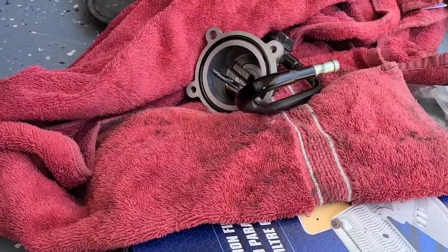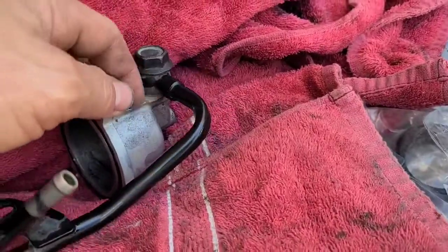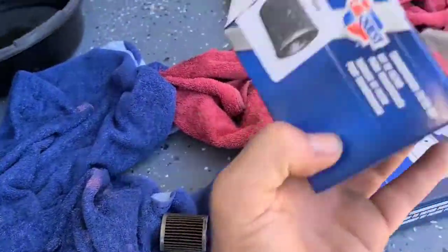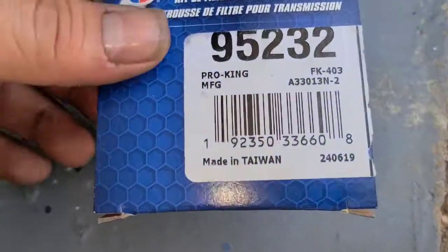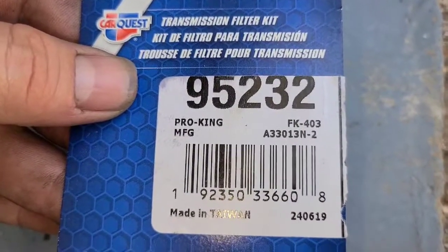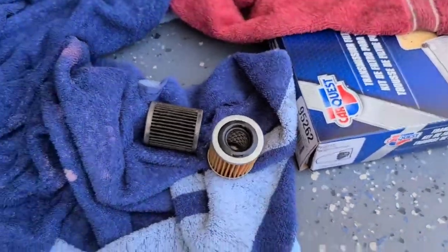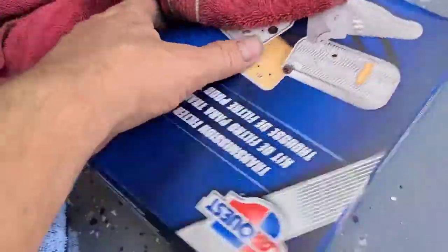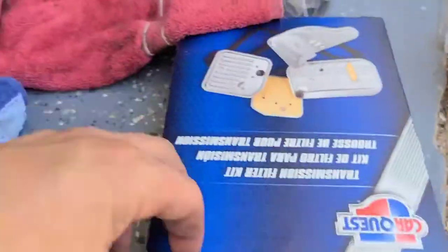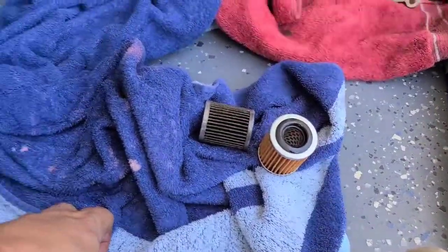That's why this line is coming back from the radiator, comes down here and goes back into the transmission from there. Some of them just have a housing that has like air vanes on the side of it for cooling, so it might look a little different but it's still the same concept, same type of filter. This is the filter I got - made in Taiwan. I got it from Advanced Auto Parts, only a few dollars. That's their part number for the transmission cooler return filter. We're also going to change the strainer in the transmission and change the pan gasket there, so I'm in the process of doing that right now - I'll just knock out this filter first and then move on to the other part of it.